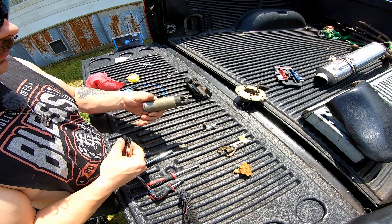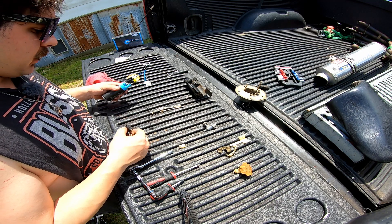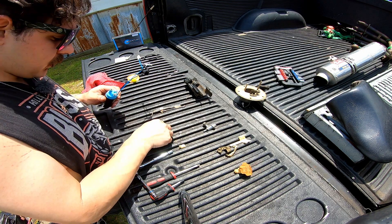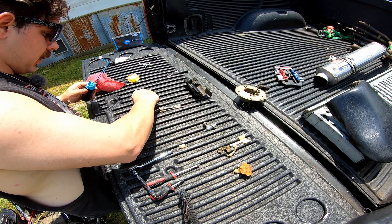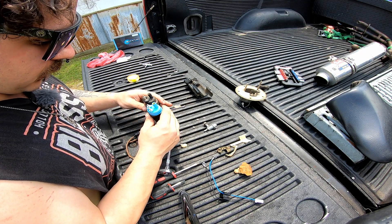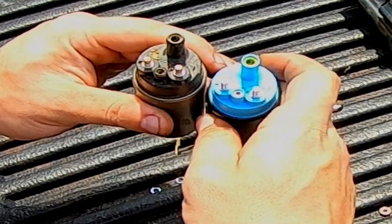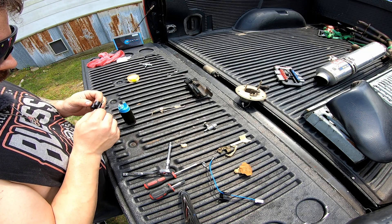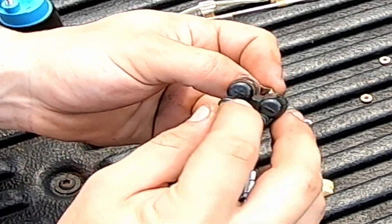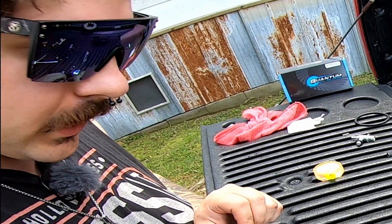There's our old fuel pump — it's probably still good. Since I'm not using the new wires, I am going to use the new nuts and stuff. We'll take those lock washers and nuts and put them to the side. I'm going to compare and make sure they are set out the right way — positive, positive, negative, negative. We're lucky enough to have negative and positive marked on this as well. Match up the plus signs and the minus signs here — we're not fucking hooligans.